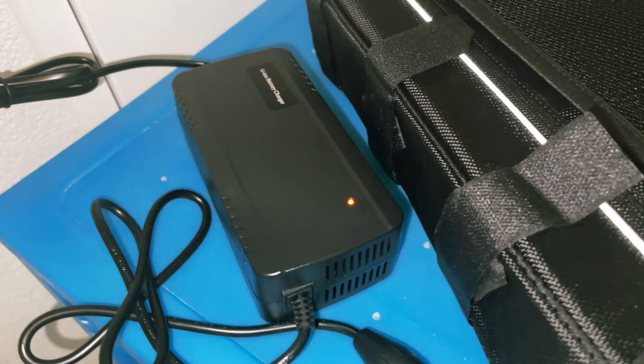While purchasing the battery, you should not just look for its capacity, but also for a maximum tension of 24 or 48 or even 52 volts. It depends on the motor you will choose. For my 1500 watt motor, I need at least 48 volt battery. You can buy different forms of it. It can be triangular or rectangular. Again, everything depends on your configuration and your personal needs. Usually, the charger for the battery is shipped inside the box as well.